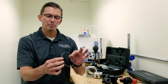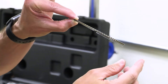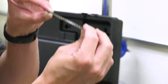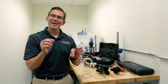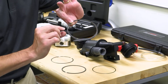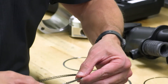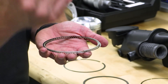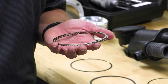The expander keeps the two oil rails separate. It has slots through it that allow the oil to drain back, because it's the scrapers that actually touch the bore, not the expander. And the expander is actually the spring that creates the tension.